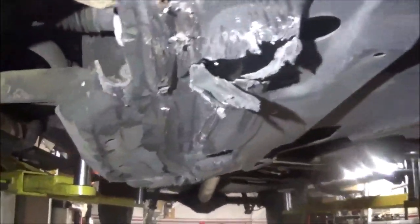All right. Good deal. So whatever he hit, he messed everything up — starting from the front right here and it went all the way back. It dented the pan, but we took the pan down and beat it down because we had to check to see if it messed up the computer in this transmission. This is the 6L80. We don't see that the computer is messed up, but this thing isn't running right. So we've got to actually change the transfer case and the driveshaft before we know if the transmission is messed up.